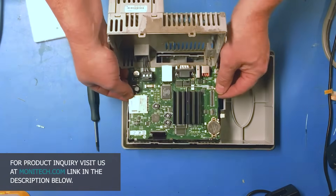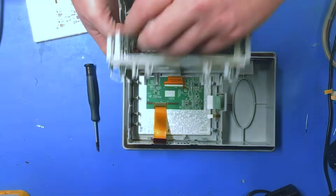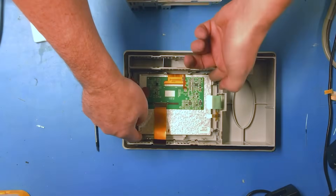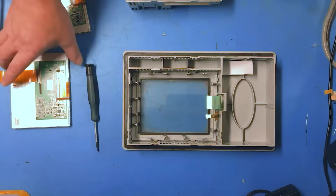After removing those cables, lift the panel. Some of the clips may be broken — I didn't realize it when I did the video. There are four clips that you might have to use needle nose pliers to get in there and pull off. Once you do that, pull the LCD panel off — the LCD panel is not screwed in or anything.